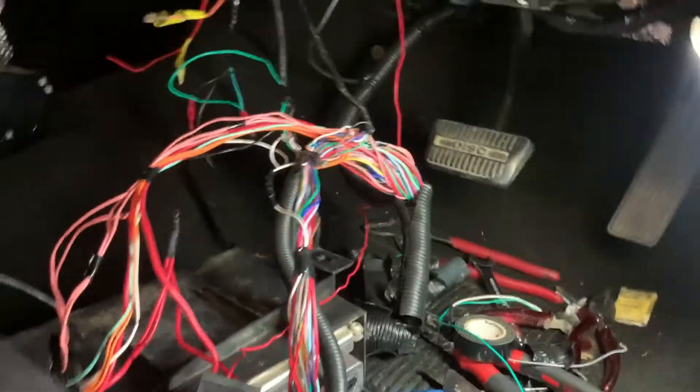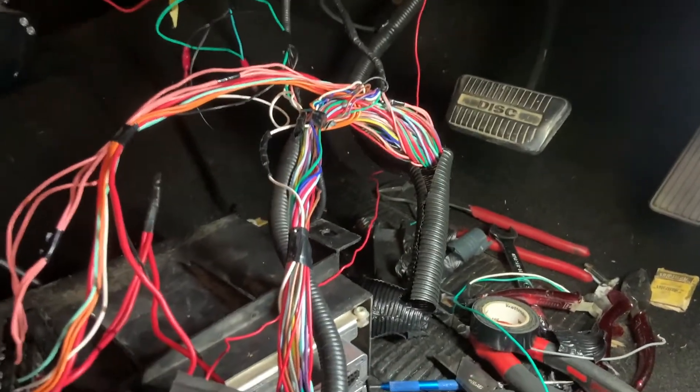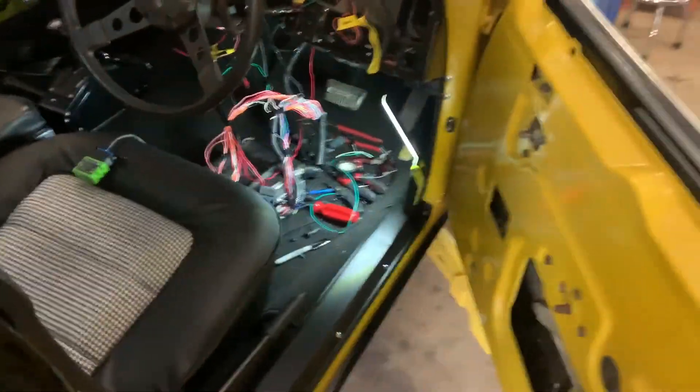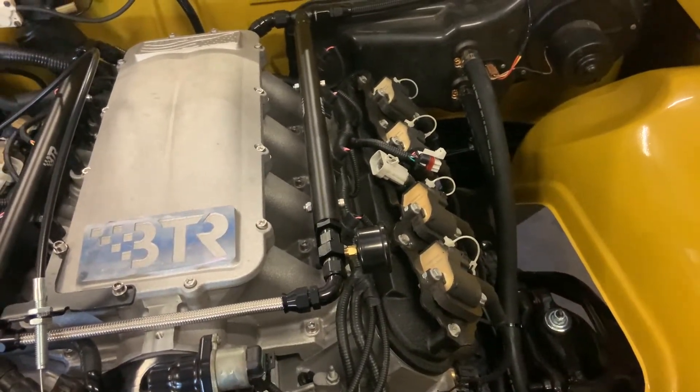Just an annoyance. What I've decided to do now is put an Autometer 9117 module in. That one involves splicing into the coil harnesses — it wants to see the power signal to both coils. Usually the instructions say to do it up at the motor, and everything up here is quite neat, all sealed up.